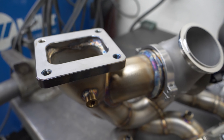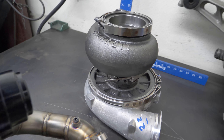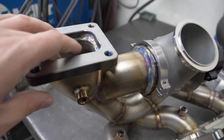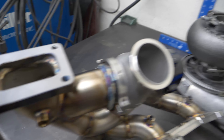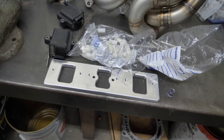What does that tell you? Well, it's really relative to be able to see how much back pressure your turbocharger and the rest of the exhaust past the turbocharger is causing. Rotary engines, like most engines, hate back pressure. So we can measure, and you could try different turbos and different things to see what housings and what turbochargers are giving you the best results.